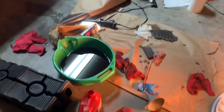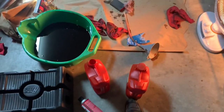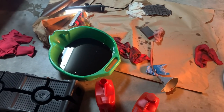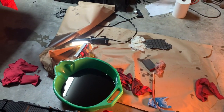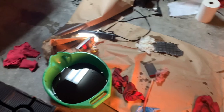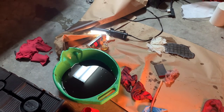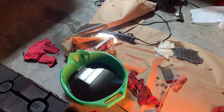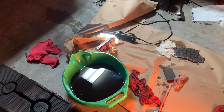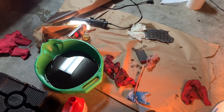Here's the aftermath. You always want to make sure you recycle your fluid — I just use the jug it came in. I've got five quarts in there with about three quarts still good, so I'll find another container for the extra quart and take it to an auto parts store to recycle. Don't dump it down the drain. I did crawl underneath the truck and verified there are no leaks. Monitor your stuff the next couple days to make sure that gasket's not leaking and you should be good to go.